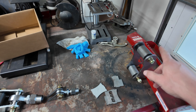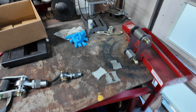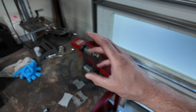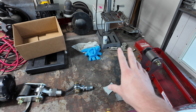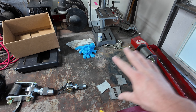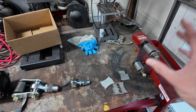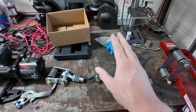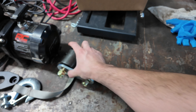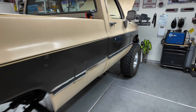I opted not to buy their tube — it's a little expensive. Since I'm already waiting on tube bending equipment, I can get it cheaper myself. All I have to do is buy tube and this kit is complete. I'll cut the tube to length, try out my new notcher, get everything tacked up, welded in, and adjusted. The most fabrication I'll have to do is actually building a cross member for the shackle to mount to, so I need to figure out exactly where I want to put it underneath the frame.